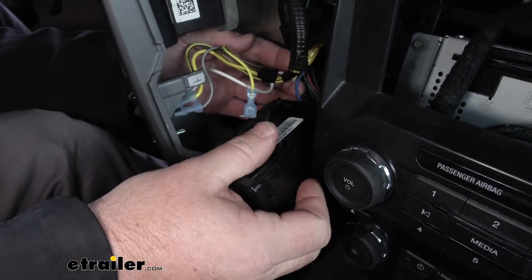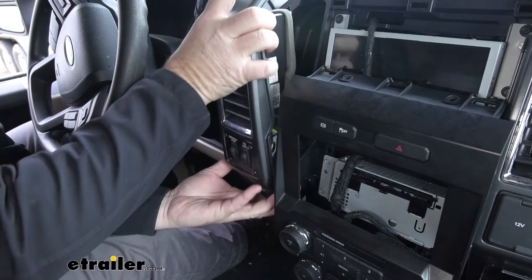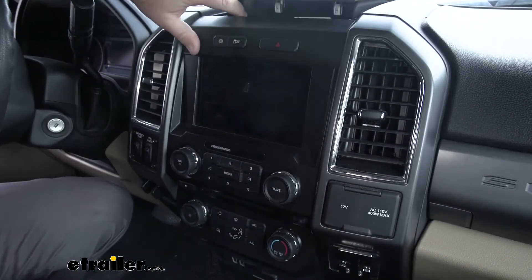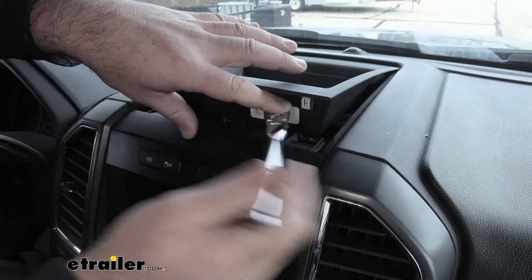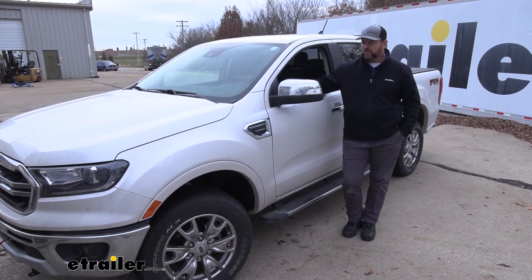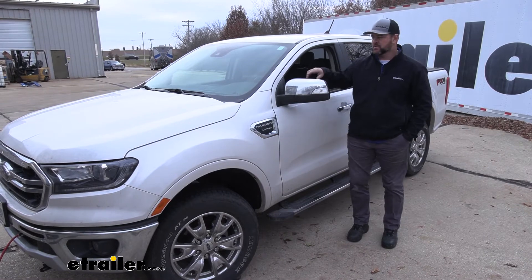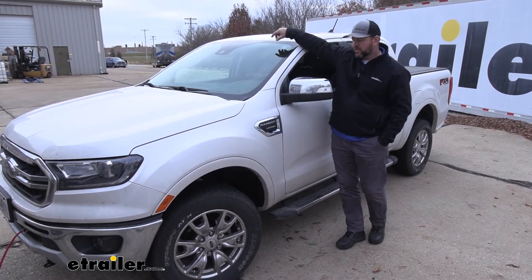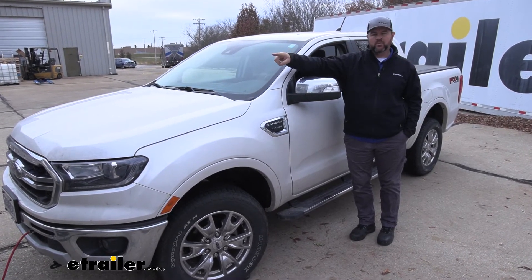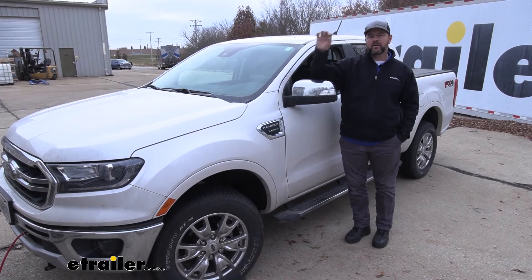So now go ahead and put everything back together and test it out — make sure it's all working correctly. Once you get everything connected on the RV side, as I mentioned earlier, they're towing a vehicle. We had to tie a wire into the braking system on the vehicle, which is actually just the indicator light that's already on there — they were having a hard time seeing it. We just tied the wire into it and ran it up to the six-pole plug. Then you just want to make sure that your wire coming out of the six-pole plug is matching where the blue wire is on the seven-pole plug on the RV side, so that when the brakes are applied on the braking system in the vehicle, the red indicator light inside the RV comes on.